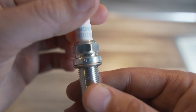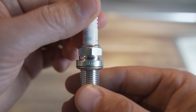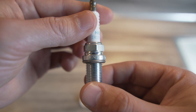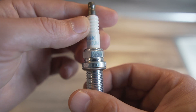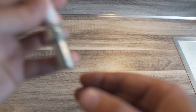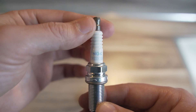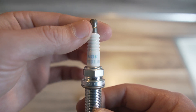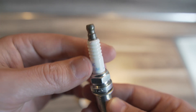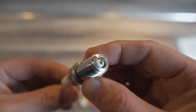Right here you'll have 'Japan' and you'll have the number — the R7438-9. After that number I count four stripes, and then it's the word 'Japan', then 'NGK Iridium'. So these are the plugs — make sure you don't get fake ones. You don't want these things breaking off in your engine.